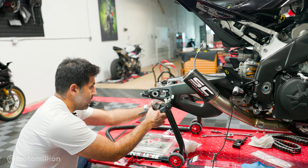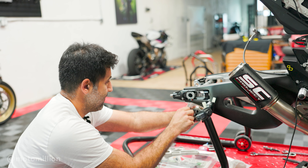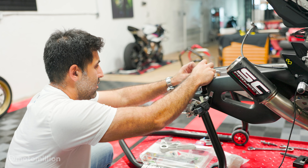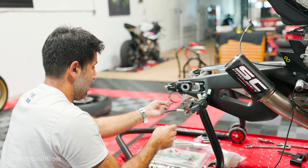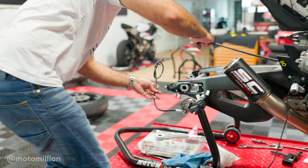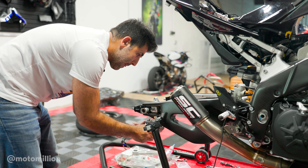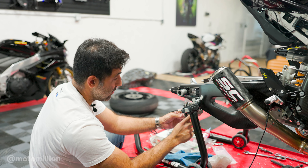I'm going to change my caliper bolts, but before I change those bolts, let's just hand-tie this on. I'm going to put the line somewhere — like this. Now is the time we're going to make a mess: we're going to remove this line and get our under-slung line together. I figured out on the previous bikes that we can run it through here, just like that — and then you can see the lines are perfectly positioned. We have enough clearance for our bleeder so that we can bleed the brakes.